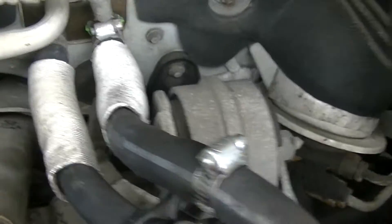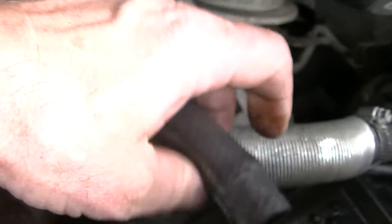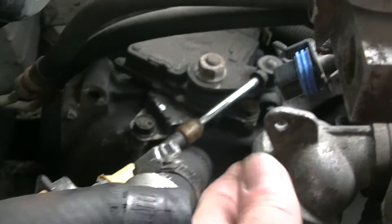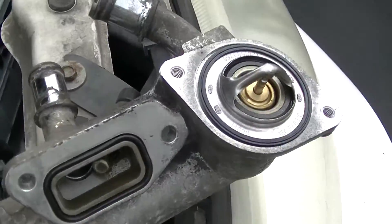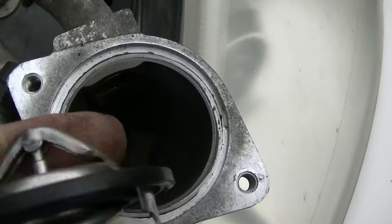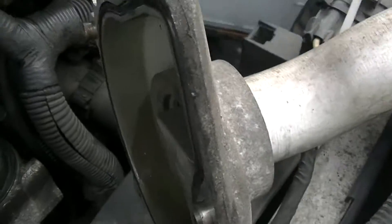You've got to take off some of these hoses — I think it's a 5/16 or something. There are your heater hoses, they go right there, at your thermostat. The thermostat goes in here. This is the other half of this part. Make sure it's in the right way — that's the most common mistake. It'll fit but it's wrong.